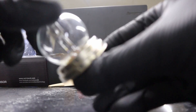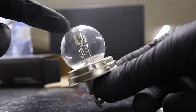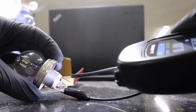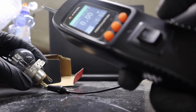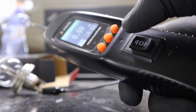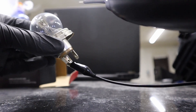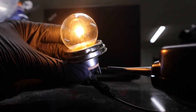The same way I tested fuses, you can test any other component — for example, this light bulb. This can be very helpful if you don't know if a component works: simply take it out of the car and test it. I put the alligator ground clip on one side and we can hear continuity. You can also actually test if the light bulb works using this button. I have the ground and positive leads connected to my car battery — pressing the button up applies power, pressing down applies ground. So with ground already connected, I just apply power and the bulb lights up.